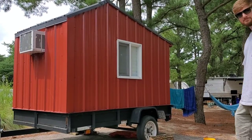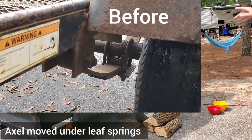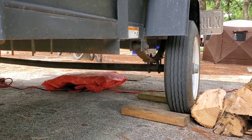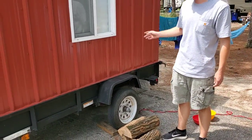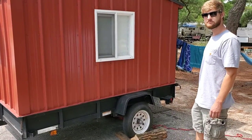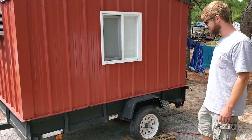Now I have to ask — most viewers wouldn't notice this but I noticed it because I have the same trailer — did you switch the axle around? I did. When I first built it the axle was a little higher, but I noticed my tire was actually hitting the fender on the other side because the fender is welded further back. Flipping the axle to the bottom gave me enough travel so the tire wasn't hitting. Plus, since you have the Toyota Tacoma, it gives you a lot more off-road clearance, which is really nice.